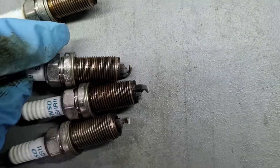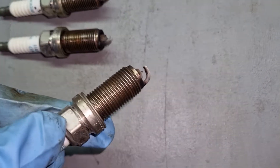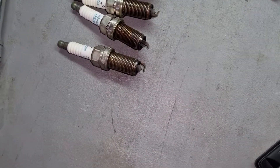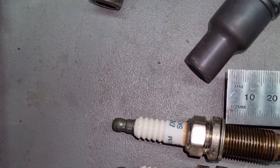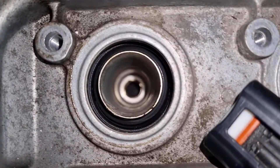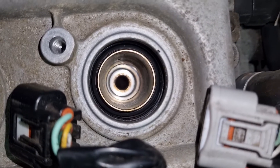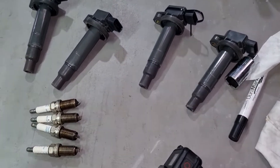You can go ahead and measure the gap using a feeler gauge if you're going to be reusing the plugs, but there's really no way of cleaning iridium plugs. You can't clean them at all — you can try a wire brush but I wouldn't recommend it especially with iridium tips as they can be quite fragile. Remember these are the long reach plugs specified for this particular engine. Also check for any oil in there — that usually indicates a bad rocker cover gasket and spark plug oil rings. Replace that before changing your plugs otherwise it can also cause a misfire.